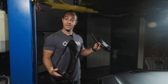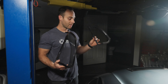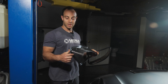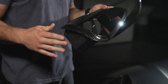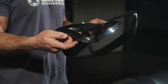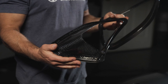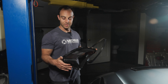We've been asked quite a bit about our fender vents for the Supra, which is cool because that means you guys are interested. These are progressing forward. At the end of the day we were having an issue with fitment — on this bottom side flange, this top side is curved, it's actually raised and has some curvature to it. There's actually a top mold, and as a result the bottom was not fitting to the hood's contour as well as we would like.